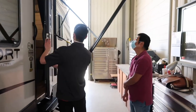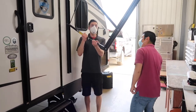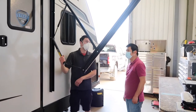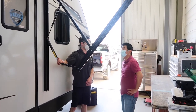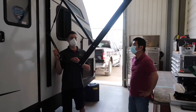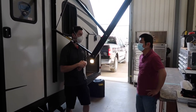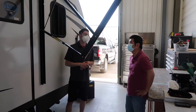There is also a pitch feature on either arm. If you want to use the awning while it's raining, you can still do that — you can have the rain beat off one way or the other by pulling down the arms. I always recommend putting the arm back to straight/original before you bring the awning in. No matter how you have it angled, the awning will roll in, but putting it back to original first ensures you won't have any problems.